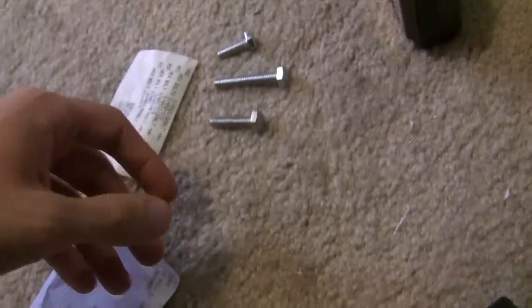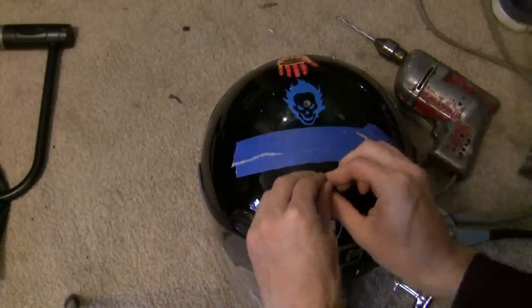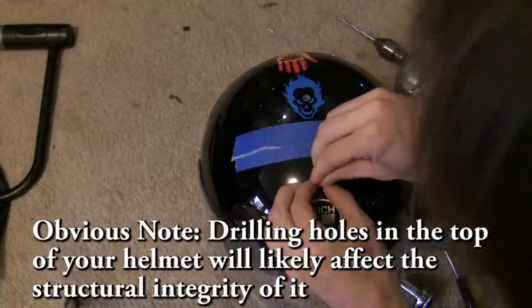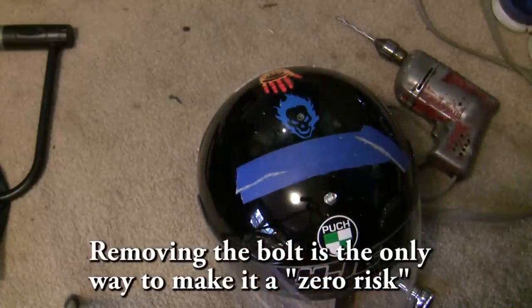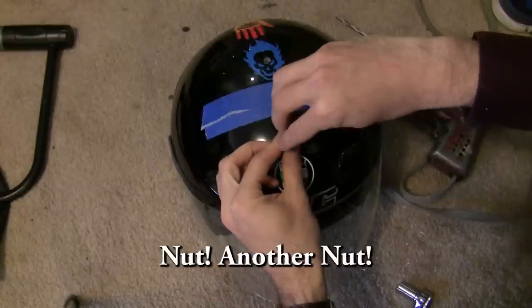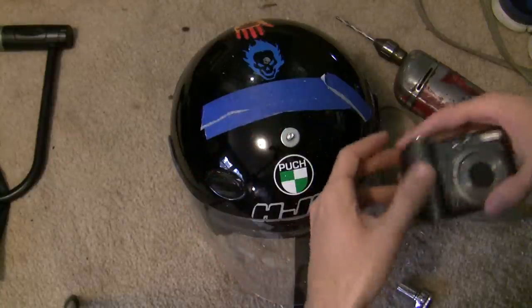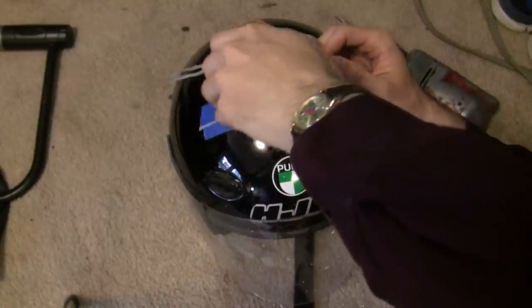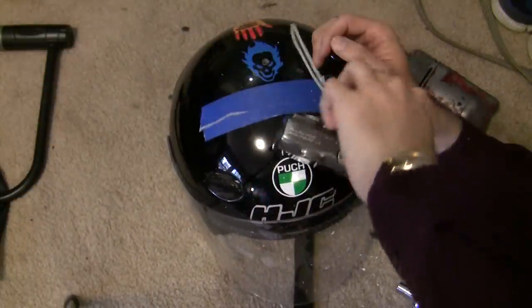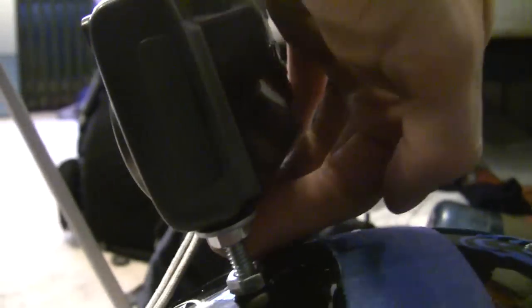I'm obviously not going to need the two and a half inch one. Let's take the one inch for example — stick that through here. First things first, we'll go ahead and thread a nut on here. I want this to be somewhat removable in case a friend comes over and wants to ride one of my bikes and they don't have a helmet — just so there's zero risk of this going through your head if you crash. Now I'm going to do another bolt, then take a washer because I want the camera to sit on something flat, and then I'm going to extremely gently screw this camera on here, very gently until it hits the point where it stops. Then I'm taking the nut right under the washer and loosening it slowly to tighten the washer against the bottom of the camera.